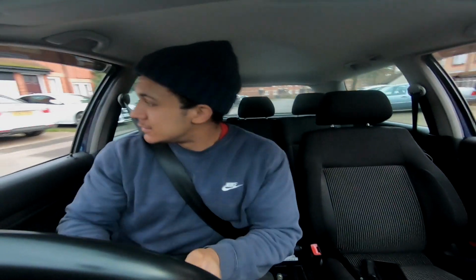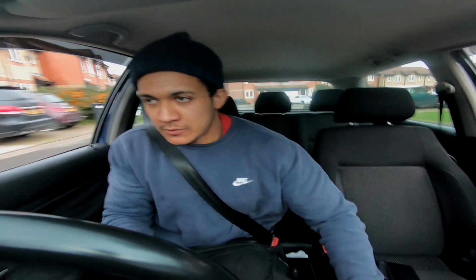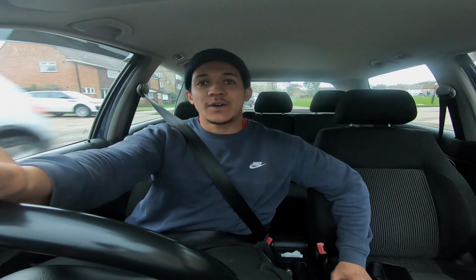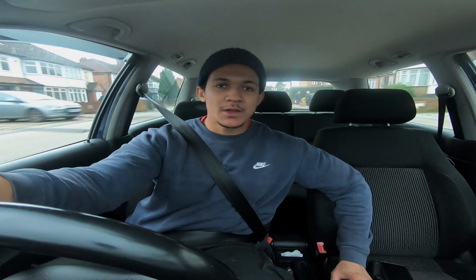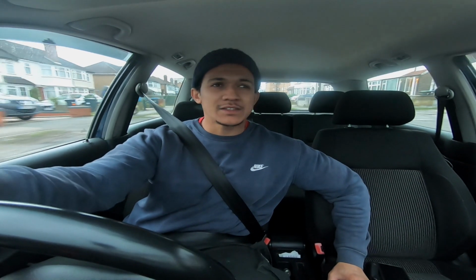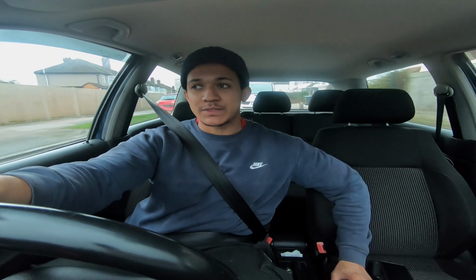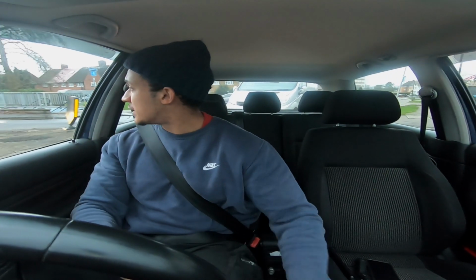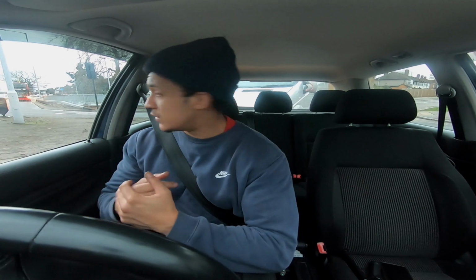Sounds good. Sweet. So I'd say for now, since doing this job, there was something that was still happening that I thought I'd solved by swapping the N75 valve, and that was when I dipped the clutch, the revs would dip and then raise back up. I had a suspicion that I had a vacuum leak. I wasn't sure at the time whether the N75 had solved it or not, but it hadn't. But now I've done the deletes, that's solved it, and I kind of think there was a split hose that I was showing at one point to do with the Evap, and now that that's gone, I feel like it solved it. So happy days anyway. But yeah, let's go for a quick test drive, see what happens.